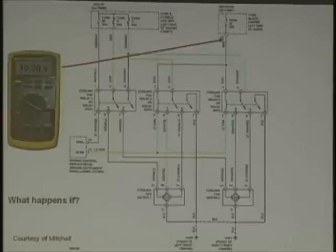PCM. If that's the control wire to the PCM, what does the PCM do to that wire? And if it's calling for fans, that wire is grounded. And if that's grounded, and we've got that voltage at this test point, where the arrows show, what would you expect to be happening? Possible causes. The PCM isn't grounding it properly. It's not grounded. That's not really...